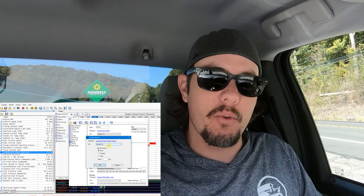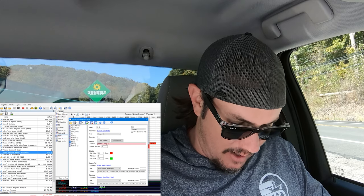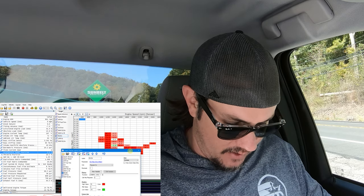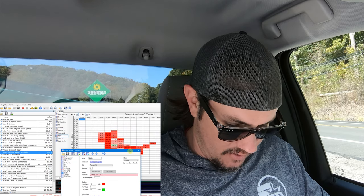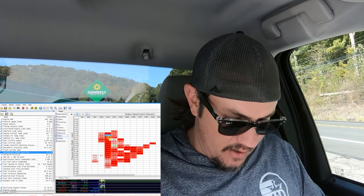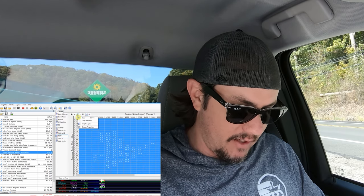You've got to make sure that reads up properly or else you won't filter it. If you left it as number, it would be 0.00 to 1 as opposed to 0 to 100%. We want this anytime it is greater than zero. Let's bump it up a little bit more and see if it takes care of any of these. We're still getting some bad cells on that one — this one right here, 132. We are not 132% off on that one. We are pretty far off from here to there though, so we can probably smooth in between. We'll leave it as is for now.